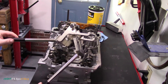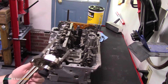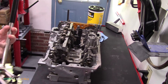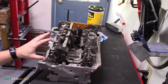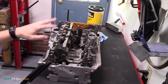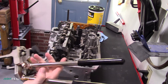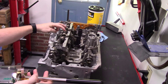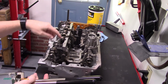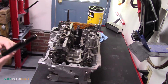You need a special tool from BMW to do it. I can't remember the part number but I'll look it up and stick it in the video for you. This isn't like a normal intake camshaft removal — you have to use this tool and put all the springs in the correct position before you take it apart. I've already taken two of them out, so I'm going to shoot a quick video on how to do it and how to use the tool.